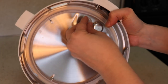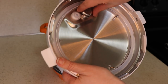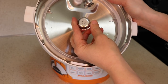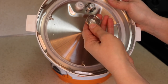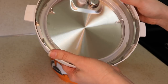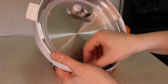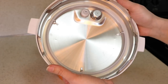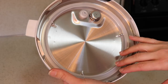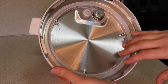To put it back in, you just pop the little cap back on and it is ready to go. On the underside of the pressure release valve there's a cap and it also comes off for cleaning — some of these come off easily and some of them don't. That's the little cap and every once in a while it'll get gunked up with food if something boils really heavily, so you might need to clean that. The other part of the lid that is removable for cleaning is the silicone ring. You can pull it all out and clean it, and if you ever have an issue with the Instant Pot coming up to pressure, check your silicone ring and see if it's inserted correctly. Very occasionally these silicone rings need to be replaced — not more than once a year — but if you do start having issues with your Instant Pot coming up to pressure, that might be something to try.